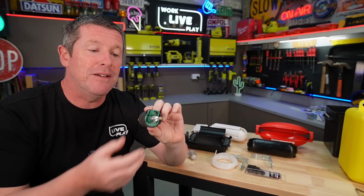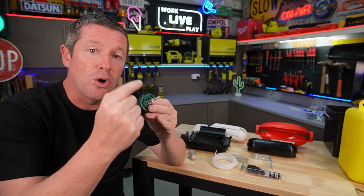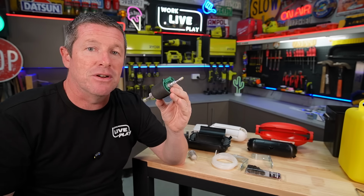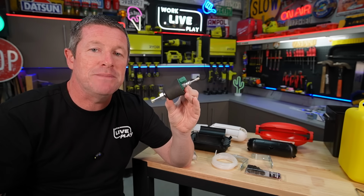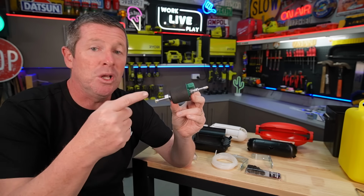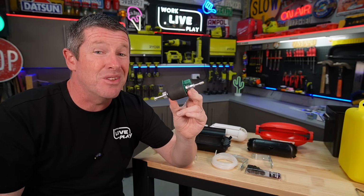What quite a few people have discovered though, is that the noise is often caused by the pulsing through the fuel line that runs up to the heater itself. So the closer you can get this to your heater, the quieter it will be as well. You can actually position these pumps 2 meters away from a tank. I know of some that are actually pulling 3 or 4 meters from the drawbar to the rear of the van with no dramas at all.